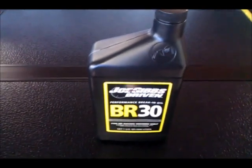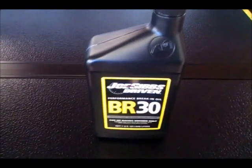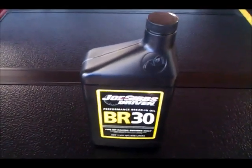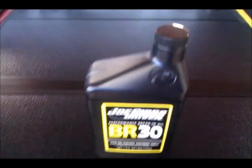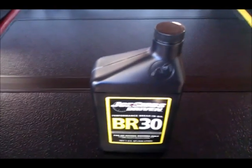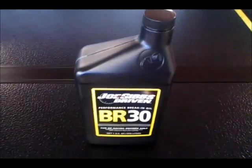The conventional oil I used was standard Castrol GTX 5W-30. Castrol GTX is a good conventional oil, but you don't really want to run it in the motor forever since most people plan on going synthetic after that. You also don't want to run synthetic right off the bat. After about a thousand miles on your conventional oil — whether you're running Castrol GTX or any equivalent mid-quality oil — you can then switch to a full synthetic.